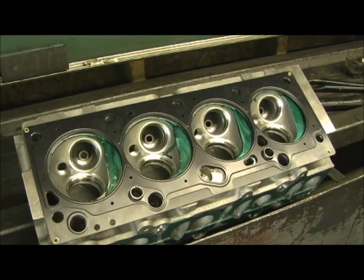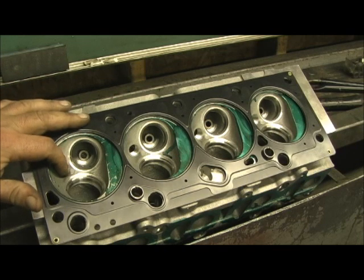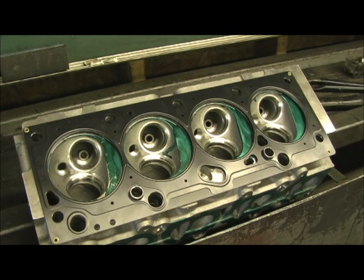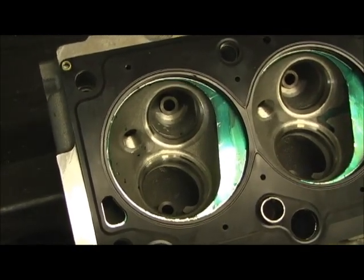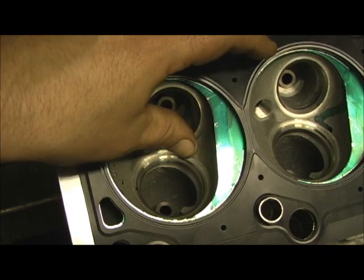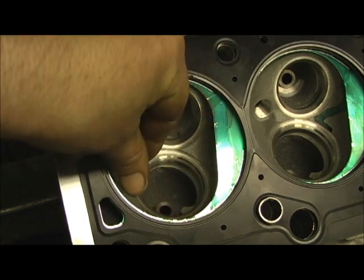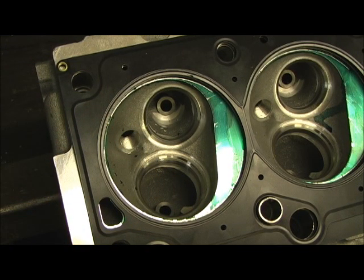The first area to work on, as I always pick, is the combustion chamber. She's got a quench pad right here — a really good centrally located, almost hemispherical type spark plug relation. As you can see, it is almost a hemi type head, a really good head design that made a lot of power and got good gas mileage, but it's got its problems. The first area where there's a problem is we got a lot of shrouding around the intake where the Serdi machine went in there and cut it. I've got to be extremely careful, mainly come in right here, make a little bit of a swoop, and pull it in right to the edges to unshroud it on the bottom — which is the low lift flow. That's the area I concentrate on the most.